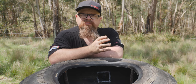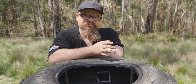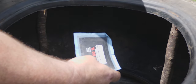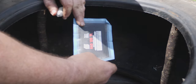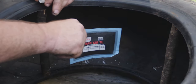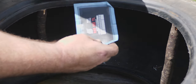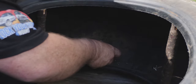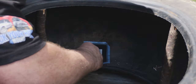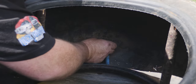At this stage we could put the tyre back onto the rim, but unfortunately I stuck a knife through the sidewall so we better get on with the patch repair. Just like before, we need to buff down the surface and work out where our patch is going to sit. Remember bead to bead - it needs to run that way. This patch is reinforced just like a sidewall is, so it needs to sit in this orientation. Sit it roughly over the top and mark out the corners.